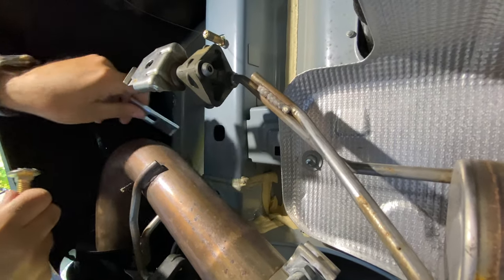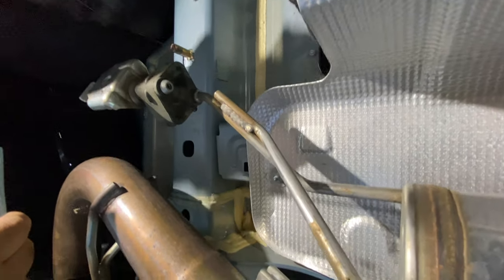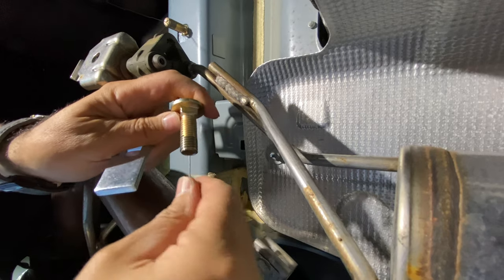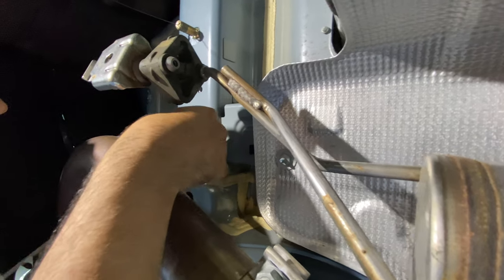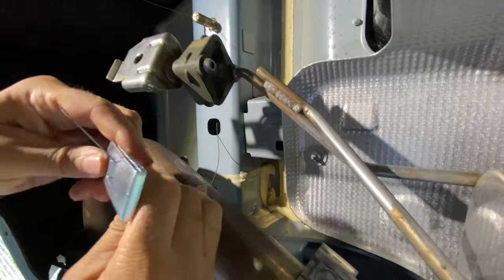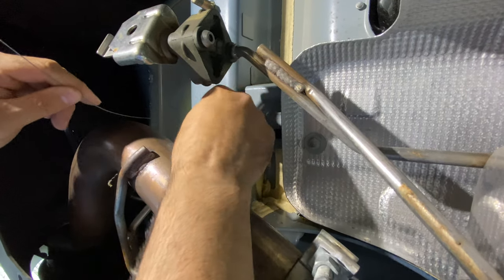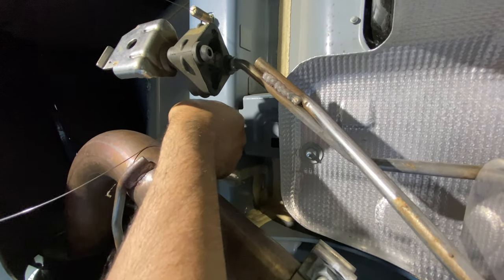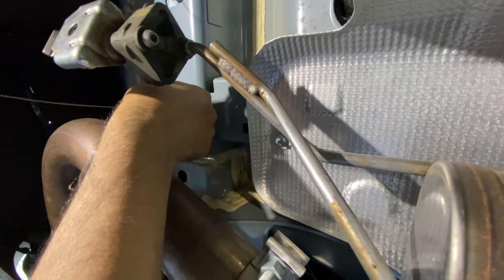So this is the hardware. Jerry's going to show you guys what it looks like when you're done. You thread on the square plate, the carriage bolt, and you have this fish screwed onto the end of the wire. Shove it up in the hole — watch this thing doesn't hit you in the face — and snake it on, get it up in the hole, then pull the bolt straight through and bind it up. Bingo, and you're done. We got those two, and now the tricky one is going to be the next one.